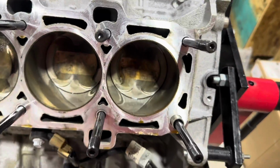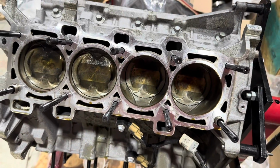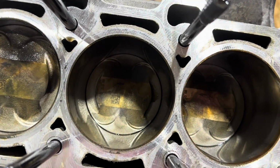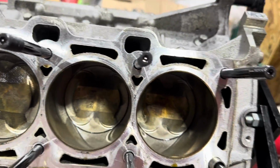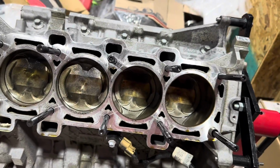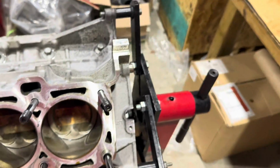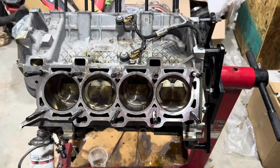I mean, you can look at the pistons, the walls. Anybody talking shit about my tuning, and I'm getting away from talking about this stuff, but the results are there, guys. If you know what you're looking at in a teardown, tell me where the detonation is. That's right. There's not a goddamn part, piece, nothing. This thing is clean. There's some brake cleaner on those pistons. They're brand new. And I was leaning on this thing hard, and there's nothing, not a single thing to be worried about. I'd say that tune was solid.